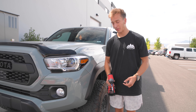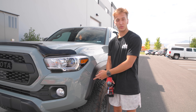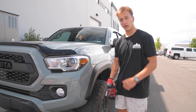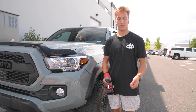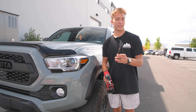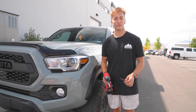Starting to pull off the bumper, we're going to start in the bottom corner. This doesn't apply to all Tacomas, but ours does have fender flares that we'll need to remove — I'll show you how just in case. The tools you'll need for this install are fairly simple: just a 10mm socket on a drill and a flat head screwdriver or pry tool. I'm just going to use a flat head screwdriver today.